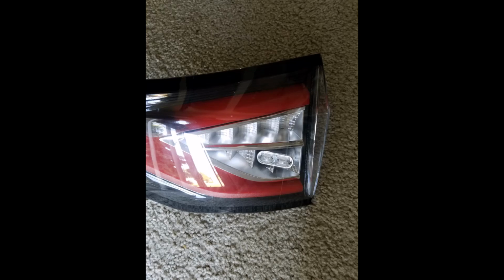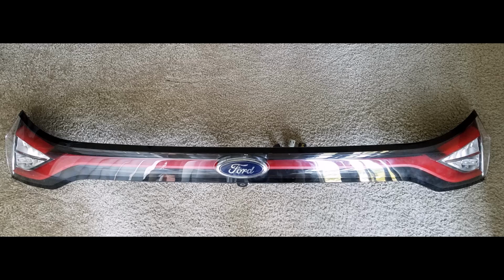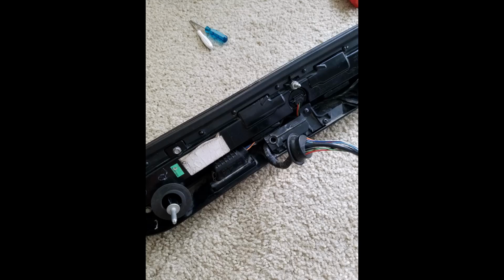But after that, my lamp looked pretty clear. I didn't see any moisture in it on both sides. So you can see it in the pictures. It looked fairly good. Also, after it was dried, there is a gap here on the top of that lamp that you can see. I just put in clear silicone and glued it, because when I was cleaning that lamp with a little moist sponge, it trapped moisture from that sponge inside the reflector. So I figured out that through that crack, the moisture is getting inside.